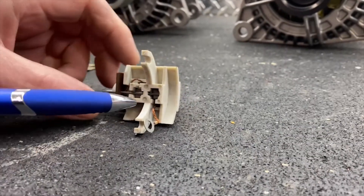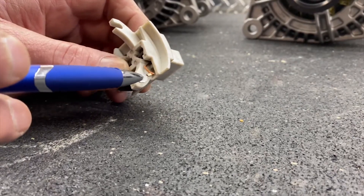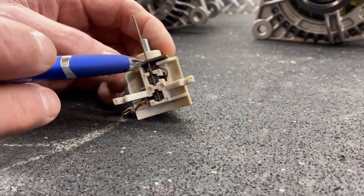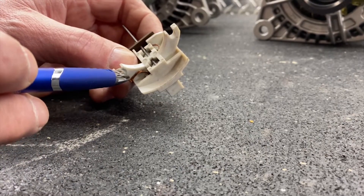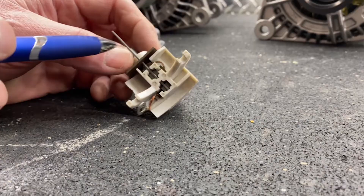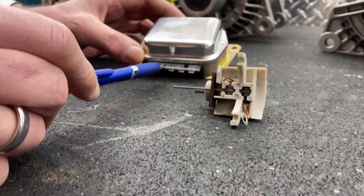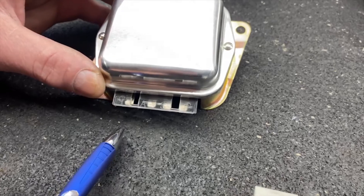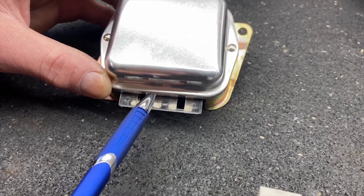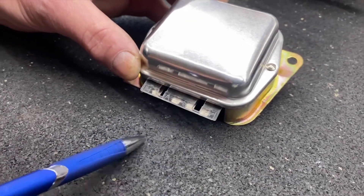Here's a typical B circuit system, using a Ford alternator as the example. This brush gets held down with a ground screw and this brush is insulated. That means it's a B circuit — one brush is grounded, so the coil has a ground and we're controlling how much positive current it gets. A typical Ford voltage regulator has terminals I, A, S, and F. It uses the A terminal to battery to help sense voltage, and then controls how much positive field current the rotor gets, being a B circuit.